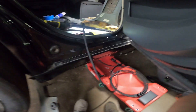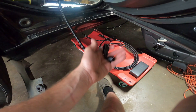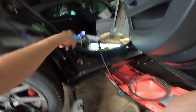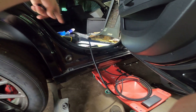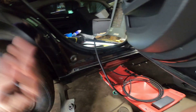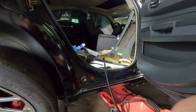I have the new grommet installed and the fuel line set in place. I'm going to install this dash 6-90 exactly how I did the dash 8 stuff - pretty simple. Put it on, install the fitting, pull it back tight. I should have done it one way from the start: install the hose end onto the fuel sending unit, then pull it tight. That's the easiest way - only one cut, and it's at the front of the car away from the interior, which could cause a very bad fire.